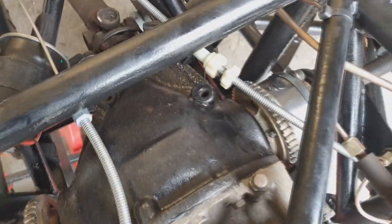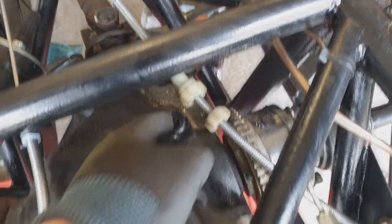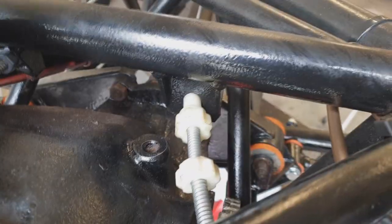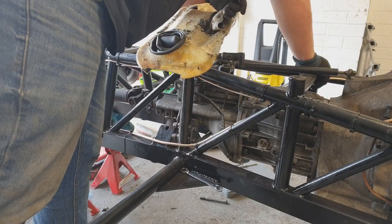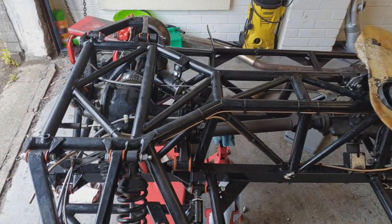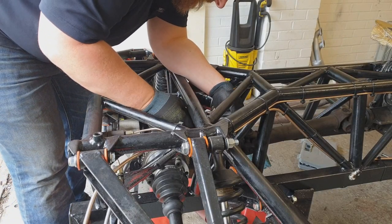The other side is where the adjustment is. Take this little lock nut away and you've got a little adjuster here — an infinite amount of adjustment. So it's about the halfway mark, and it's actually lined up pretty tight. We're going to get this as tight as it wants to go — you'll see that it's starting to pull a bit taut — and we'll pop it in this little hole. It's not bad, but I'm pretty sure we can get that tighter before we lock it off. We'll tighten her up to three clicks on the action, hopefully, and give ourselves a bit of leeway for stretch.